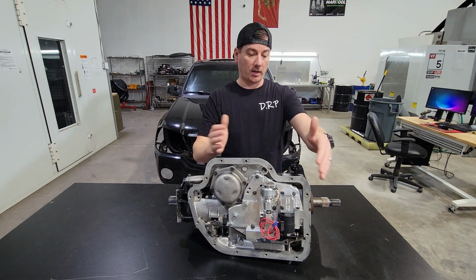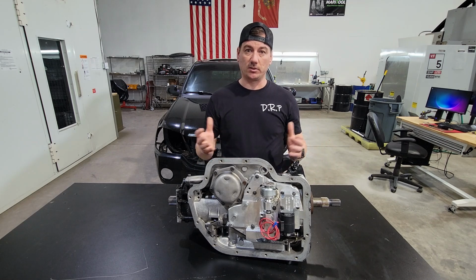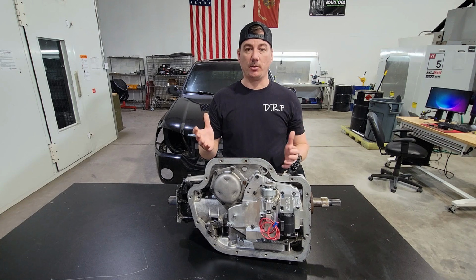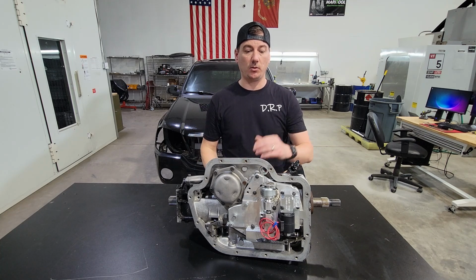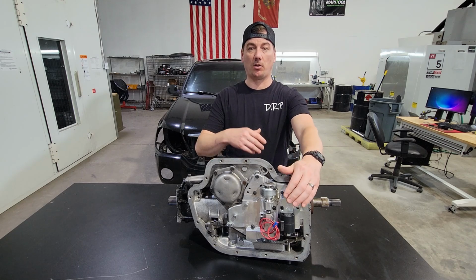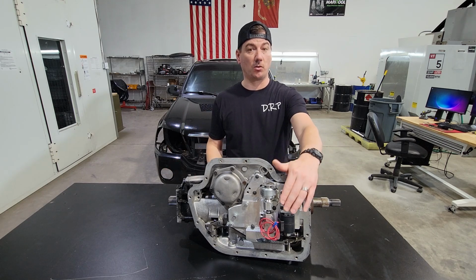So here, now we've had that cut off, we get it up to target boost. Now there's different ways you can do this. Like I was saying, you can easily sit there and say your launch boost is 10 psi. You can actually, once your ECU sees 5 psi, then this turns back off, okay, because it's normally open.